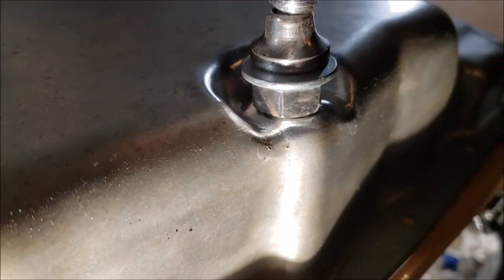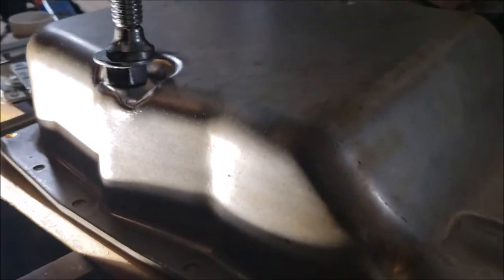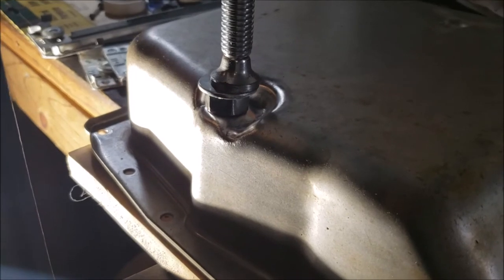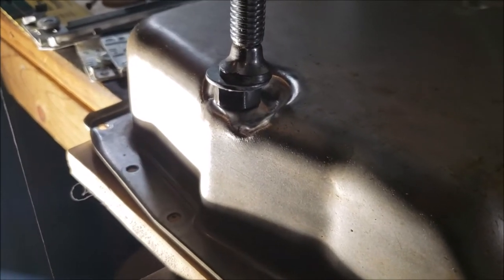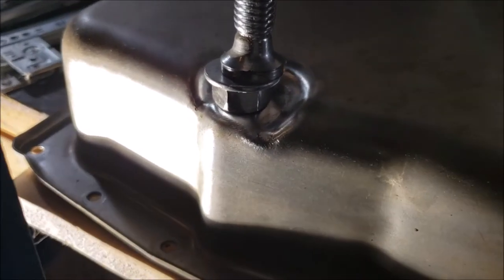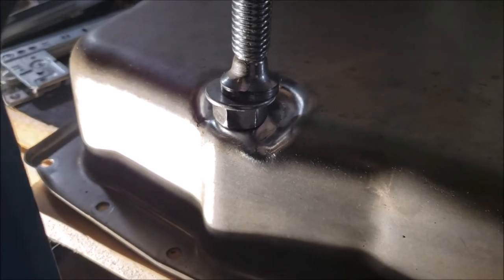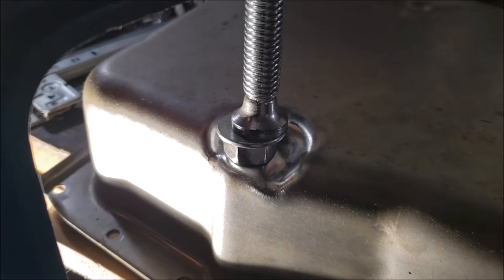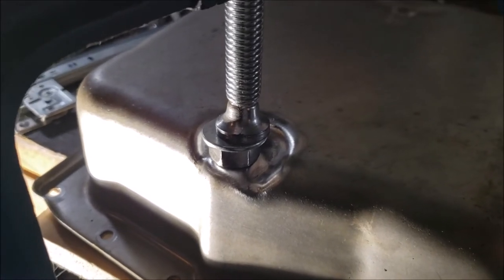What I'm really hoping is that the wire wheel on the pan — this pan's not rusted out — so unless that's stainless steel... oh. I don't know my metals. Don't let that be stainless steel, because that's going to fail miserably. That's also why I'm not going to drill a hole first — I'm just going to see if I can get a bead to stick. If I can, I grind it flush, no harm done.